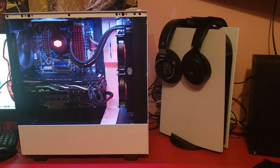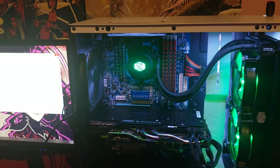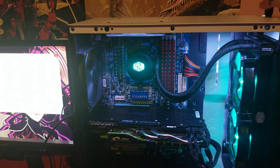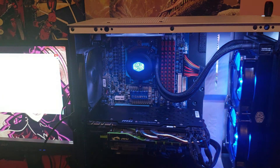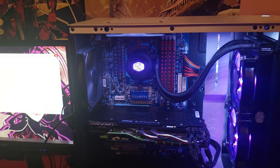I'm going to turn this on now. Once I plug it back in, it powered on just like normal. If you did everything right, the USB 3.0 will now be a USB 2.0 and should work. So we let this boot up, and then I'll take a thumb drive and insert it — it should give us a tone or show the drive up. Let's go ahead and insert a little drive. Watch over here on the screen — a drive just showed up. It had nothing on it, it's a brand new drive, I think it's an 8 gigabyte drive. Everything's working: you can remove it, it chimes and goes away. We can plug it back in just like so, and it shows back up — it's working the way it should.